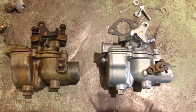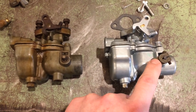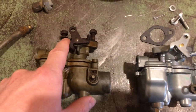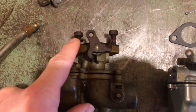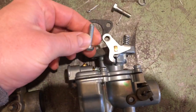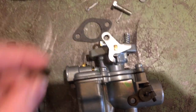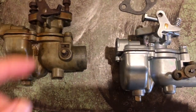When you get your new carburetor, it's not going to have the little connecting linkage on the choke plate. The old one had studs that threaded into it, but the new one doesn't have studs — it does have threads. Rather than fighting those old studs to get them pulled out, the threads on this carburetor are quarter-20, which is a super common size bolt. You probably have them in your shop. I'm just going to bolt it on rather than using studs and a nut.